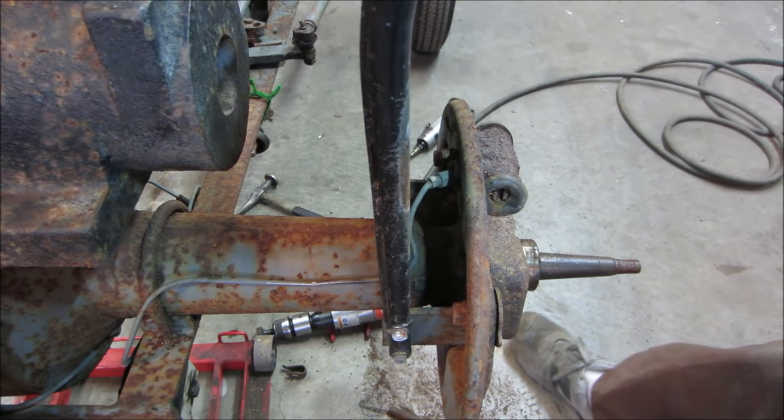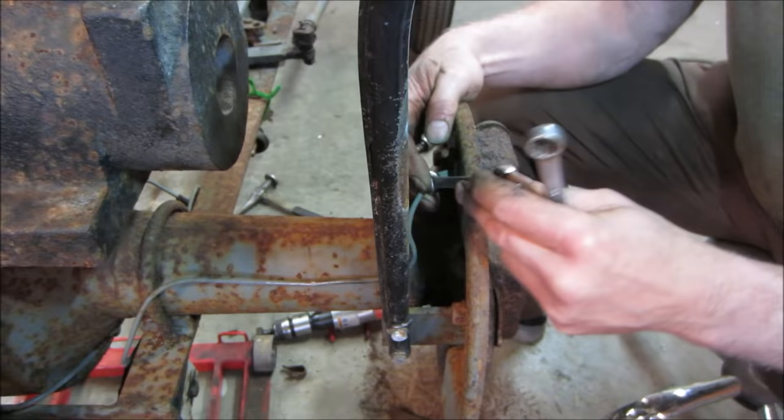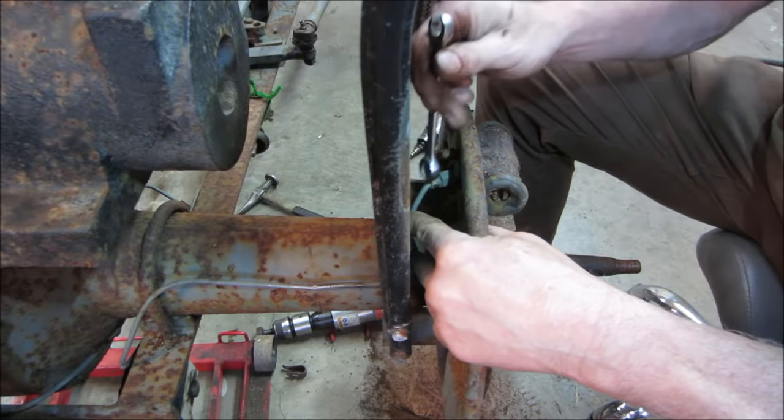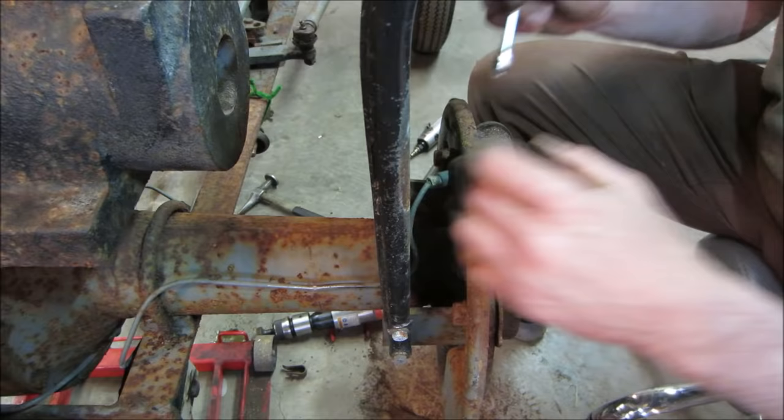While they're drying up, our next task is to see if that brake line is going to be savable. Looks like it goes into an adapter. Let's see if she'll crack loose. We need it. There we go. All right. What we needed to do is be able to spin. A lot of times the line rusts to the fitting, but that one is moving. Good. And we'll grab a 3/8 wrench, spin that off of there.